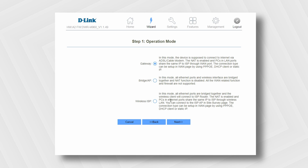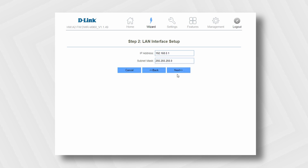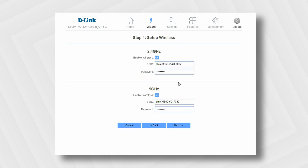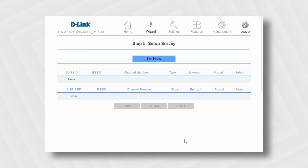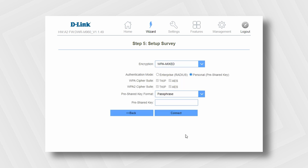The last method is using your router as a Wi-Fi extender or Wi-Fi repeater. You need to follow the same process: reset your router, connect to the default Wi-Fi, and run the wizard to configure your router. But this time on operation mode, choose the repeater option in the mode drop-down and click next. On the LAN interface setup, leave it as it is and click next. Leave the admin account settings as they are and click next. Set up your Wi-Fi as before and click next. When you get to the site survey page, click on it — a list of Wi-Fi networks will be displayed. Choose your Starlink Wi-Fi that you want to extend; in my case it's ZTG Starlink Wide. You'll be required to add a passphrase — use your Starlink Wi-Fi password. This mode does not need you to connect an Ethernet cable.